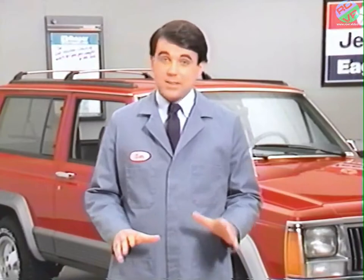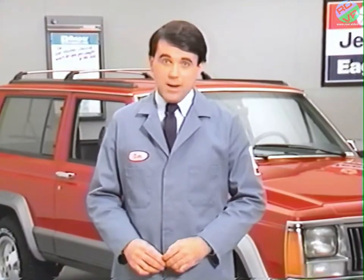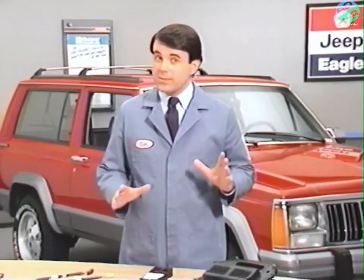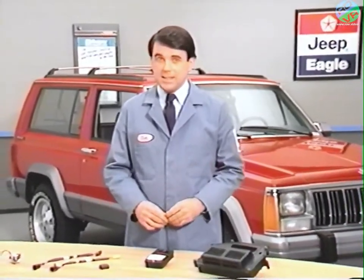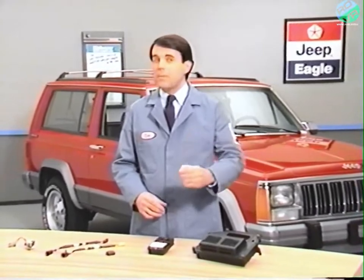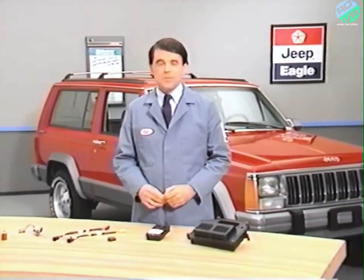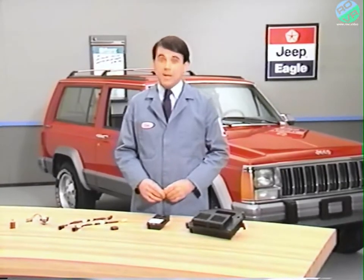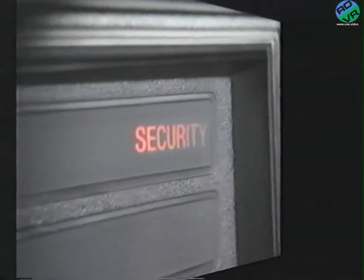DRB2 diagnostics are not offered on the Jeep security alarm system. However, the system has been designed to include a series of comprehensive self-diagnostic tests to assist you in making the proper diagnosis and repairs. The security lamp on the instrument panel can serve as a good indicator of system health. It should flash for 15 seconds immediately after the illuminated entry lights have timed out to signal that the system is being armed.